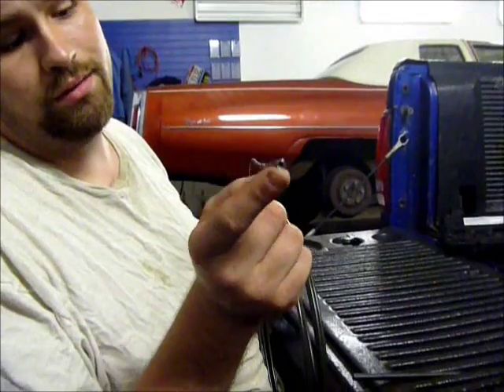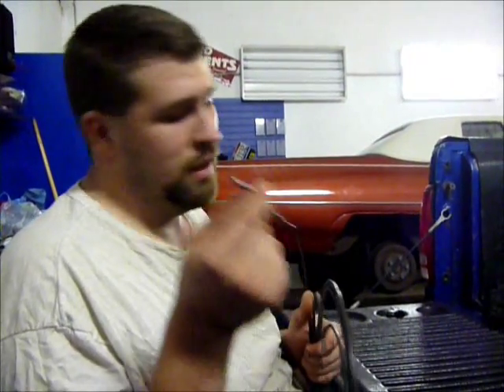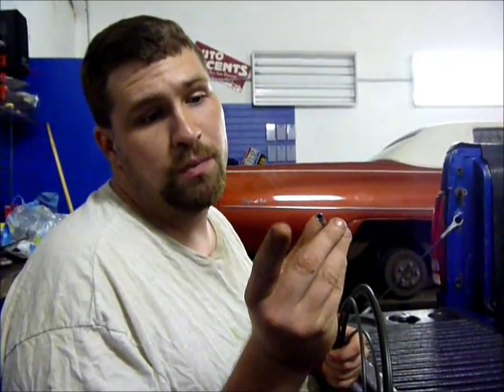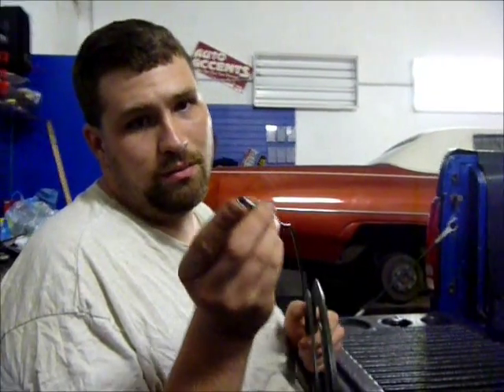And this is what you're going to come up with. Now, this double flare did not come out as perfect as it should — I think I had the arbor press at the wrong angle — but this is in general what a double flare is going to look like. I didn't put an actual fitting on this line because this is just for demonstration purposes, but once you've done this, you'll put your fitting directly on here and thread it into whatever you're going into — a line, wheel cylinder, whatever. If it comes out like this, you're going to need to redo it. This does take practice and a little bit of skill. The proper equipment helps — a cheap flaring kit typically won't do it because it will slide right through the block, but most people won't want to spend over $150 for a decent flare kit. If you liked the video, please subscribe with your name and email address below, and I'll continue to forward these videos on to you. Thank you for watching.